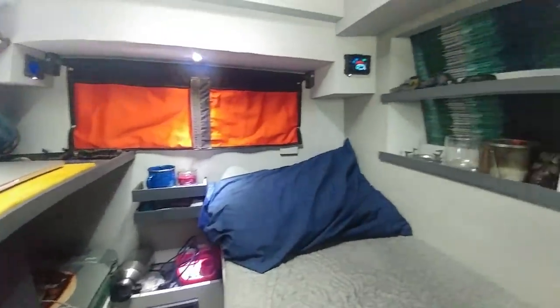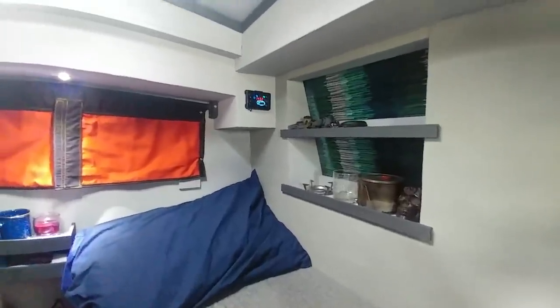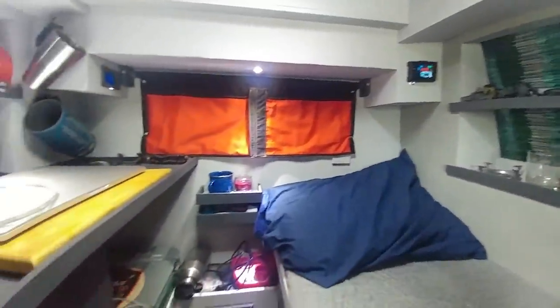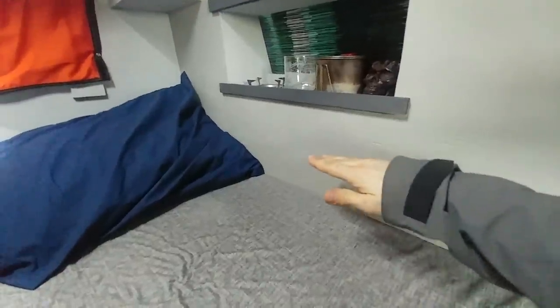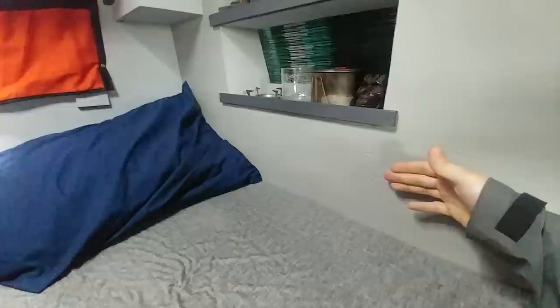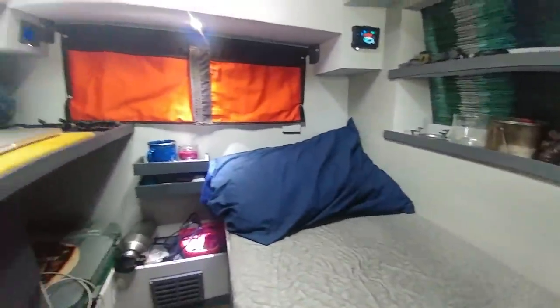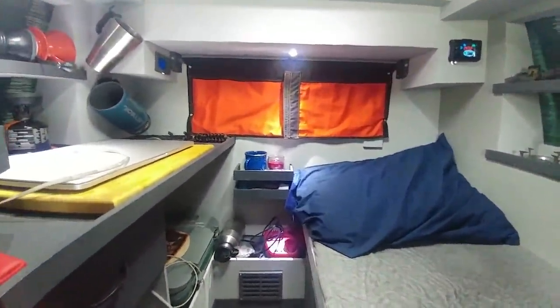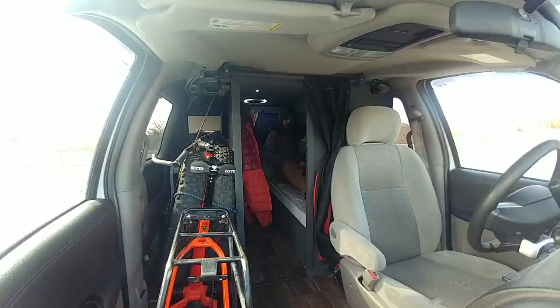One of the comments was that I wasted a lot of space building it like this, but I built it this way because I wanted to have a fully enclosed area — and it's just so much easier to work with flat walls. I think it gives you the best possible starting point for your build. One of the first problems I faced was I wanted to have the bed on top of the wheel well and it was just too high, so when I put this wall in it left a cavity of space behind it. That actually worked out in my favor because I could then mount the diesel tank on the other side of the wall and add a few shelves there. So that's one thing to think about if you want to do a similar build — don't just think about the interior, think about how you can use the exterior of the walls to your advantage as well. Thanks for watching and I'll talk to you again soon.